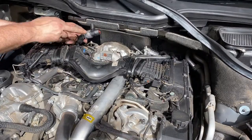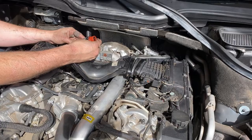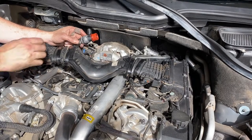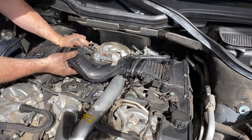I didn't realize that the new PCV valve didn't actually come with that little seal, so I'm going to take the red seal off the old one and transfer it to the new PCV valve. We should actually put a new PCV valve and a new big turbo seal - I'll do that in another video. The actual turbo seal on this car is probably about 12-18 months old, so for now I'm going to use the one off the old PCV valve. I should have worked this out earlier and bought a new one.